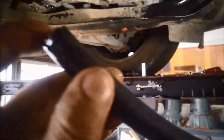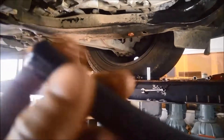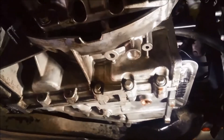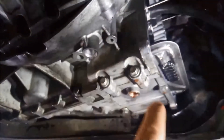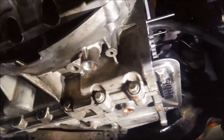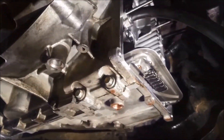We just manoeuvre it around slowly like that. Now at the other end, we can either blow air through there. Ideally, you'd force some oil back through there — make sure you use the same oil, the DCT-DSG oil. And that'll just basically reverse flush that filter a little bit. You can't clean it 100% but at least there'll be an improvement there.